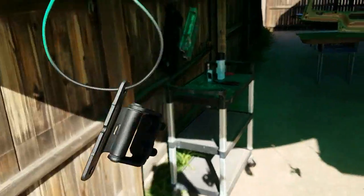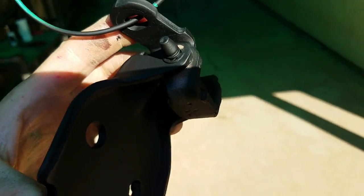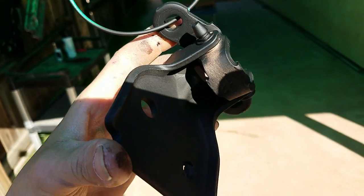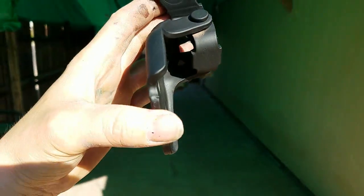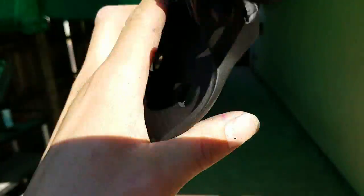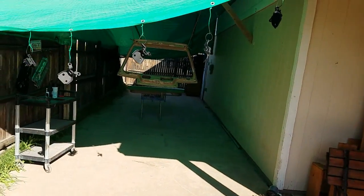Let's go get out there and see how our primer is doing on the hinges and get those sprayed. Our primer's all dry. When I'm going through spraying these, what I'm actually going to do is hold them open and spray those little sections that you can't really get to whenever it's just hanging. I'm going to go through one at a time and make sure I get those spots so that whenever I get them on the car and the door is open, it doesn't have bare unpainted spots. I'm just going to fast forward through this - let the music begin.